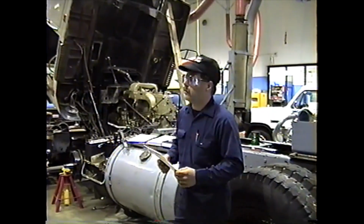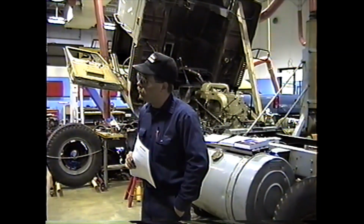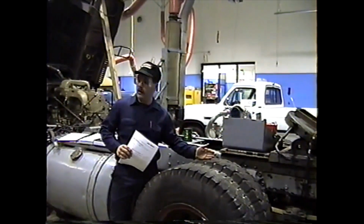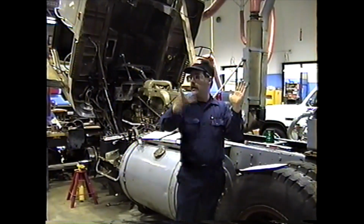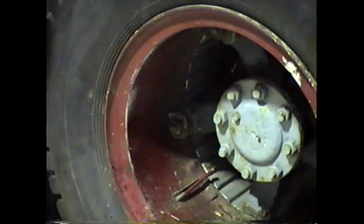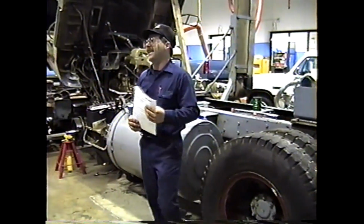Then we'll go, are there any questions on the removal? Yes, Chris? On the inner wheel? No, these wedges here hold both wheels on. On the hub, there's a taper on the back that the rim comes against, and then you have your spacer and your outer rim, and this is the other taper on the wedge, which holds all this assembly together. So when you think about it, it doesn't look like a whole lot holding those two wheels on there. There's 5 little wedges and nuts. There's not much.